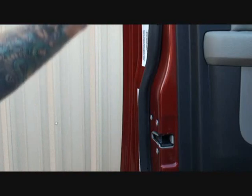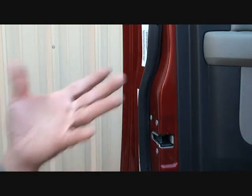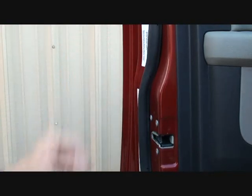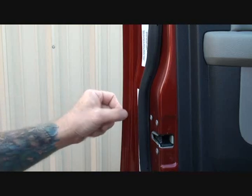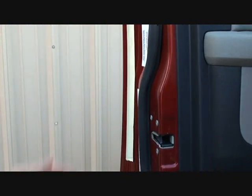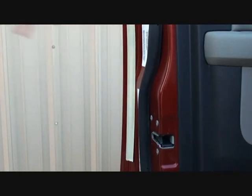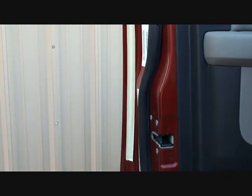Another way to back tape is if you see this lip right here where the door skin rolls over. If you're doing a high quality restoration job, painted inside and out, and you want no fuzzy look on the edge, take your three-quarter inch tape and put it right up next to the jam where the skin rolls over — exposing this lip. You do that on both doors, especially if you've removed the rubber and you're painting inside and out without taking the doors off.